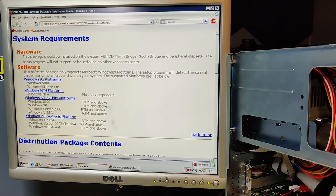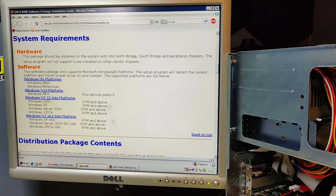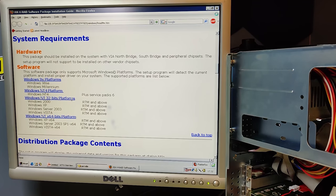I guess that if we had installed the driver on Windows NT, it would probably work, because Windows NT loads the disk drivers before it loads the operating system. No, I am just rambling. This wouldn't work because the BIOS doesn't even recognize the disk controller. So I'm guessing we are stuck using it the way we are. We actually need to boot from the hard drive controller on the motherboard, and then we can use the PCI IDE controller.